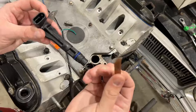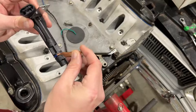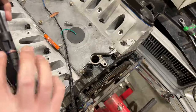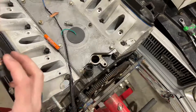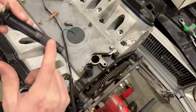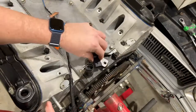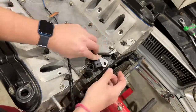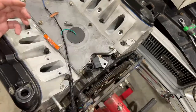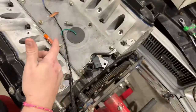Got a little copper high temp lubricant here. Recommend putting it directly onto the o-ring itself. Once it is lubed in its entirety, just simply right back down into the slot where the old one came out of. A little pressure to seat it. Now everything in reverse — putting in the bolt and torquing down to spec.